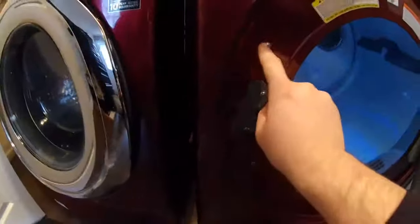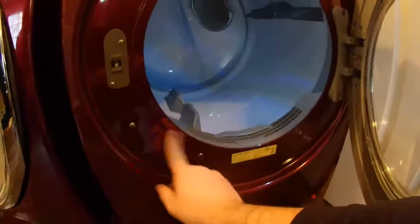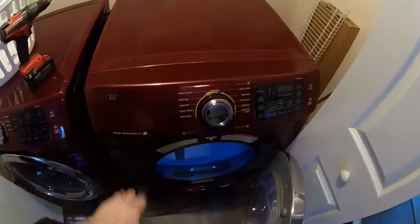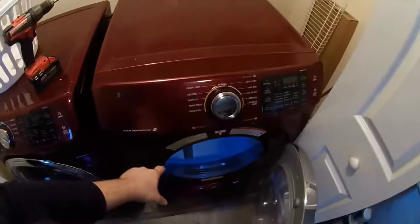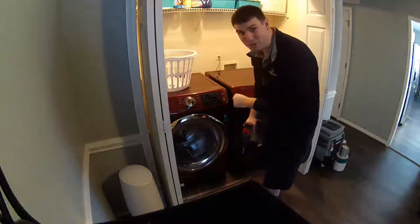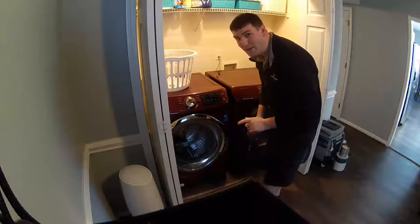I'm not an appliance guy and I've never torn into a dryer before, but I do know that when you put wet clothes in the dryer they're supposed to come out dry — and they're not. They're coming out damp, a little bit warm, and everything seems to be working normally. We've got one, two, three, four screws in the front underneath the door area, and back here we've got one, two, and then on the other side, three, four that we have to take out. The top piece will come off, the front piece will pull off held in by clips, and then we should be able to take the front door off. Being very careful not to strip these screws — you don't want to go too fast.